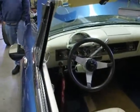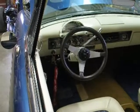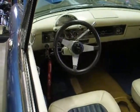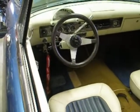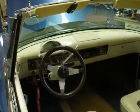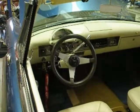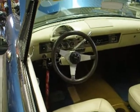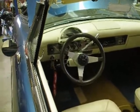Is that that new speedometer head you got? Yeah, it's brand new — Stewart Warner, on the shelf for about 60 years. Brand new. It runs — I put the wrong gear in the transmission — it shows 61 at 55 miles an hour. So I've got to change it one or two more.